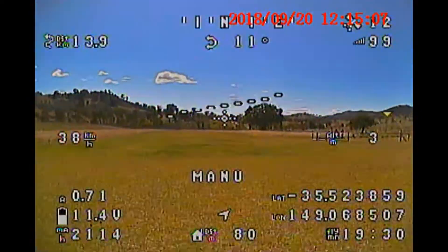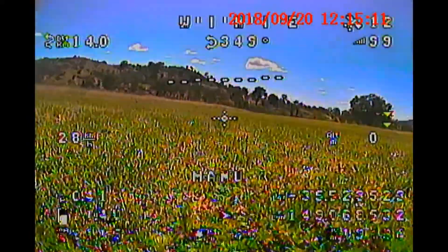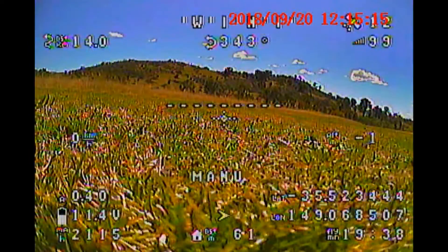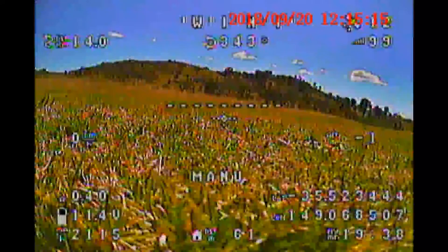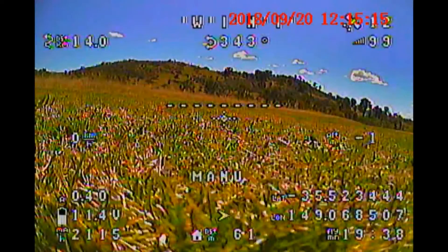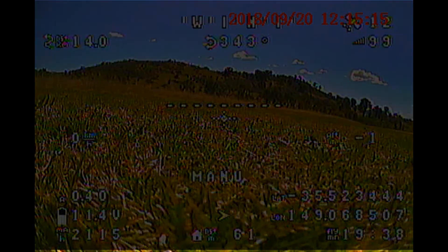All in all I'm pretty happy with the way things have gone today. The Ranger is flying reasonably well, even though I think moving the FPV gear to the fuselage has made it a bit tail heavy. I was hoping that not having to cart around a bunch of BECs, current sensors and filters would make the Ranger light enough to perform a bit better on 3S, but I'm now thinking that I might upgrade to a 4S system just to get a little bit more authority in the air. As far as iNav goes, I must admit to being pretty happy with this as a first effort given the almost complete lack of knowledge I have about the system. Clearly I'll need to do a lot more reading, but I've got enough encouragement after today to make that not such a huge chore. Anyway, we will see how it goes in the future.